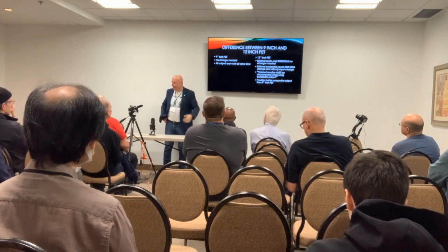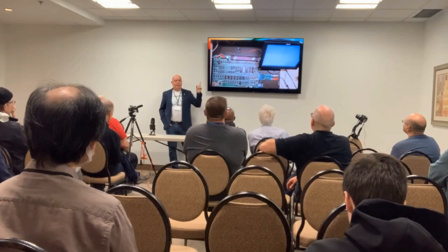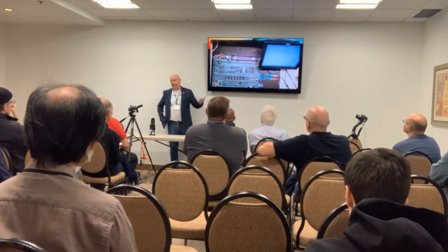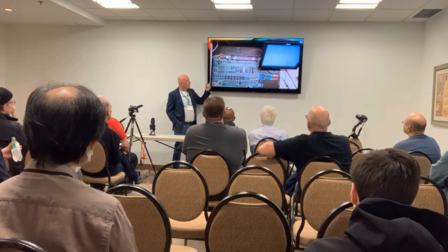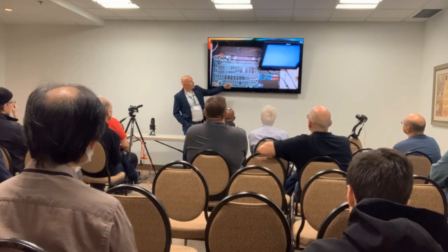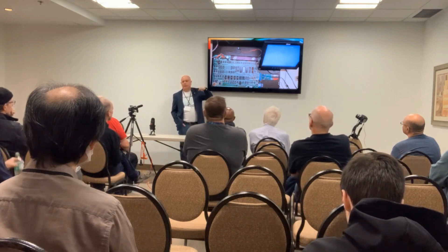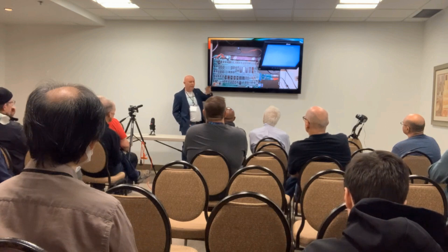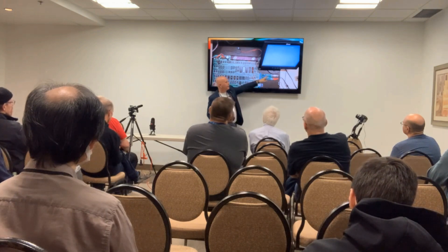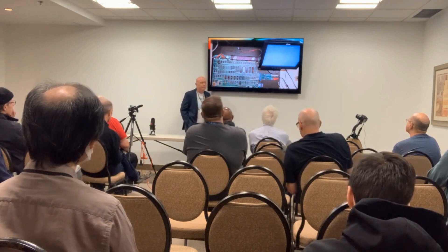Here's a picture from a video I made of my 4032. I had a problem with the screen wiggling — it was going like this — and it was an IC that needed to be pulled out, cleaned of oxide, and put back to fix it. This is the 12-inch PET board, and here is the new edit ROM I put in. This is also available on my GitHub page — if you're getting this board it's all in the manual. This EEPROM you'll have to burn. This board is the previous version and doesn't have the RGB HDMI out, but it's connected to an external monitor and working fine.